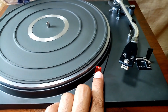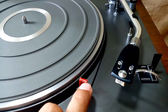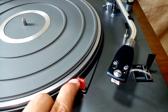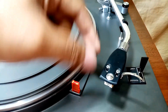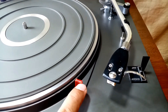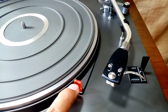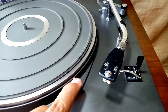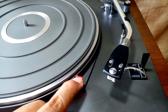This one here, guys, is not a strobe light. This is the overhang gauge. The center line is your guide — your stylus needle tip must track this center line. If your stylus needle tip is outside on this part or inside on this part, you must loosen the screw and adjust your cartridge until you get the exact center line, this white line. At least the tip of your stylus needle must track this white line, that's all.